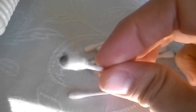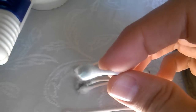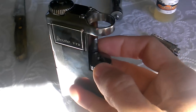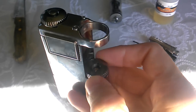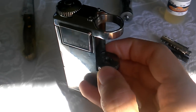If they're still coming out like this after you twist them in there, you still need to clean a lot more. They're not going to be absolutely perfect after you're done turning them in there, but once they start looking maybe a little bit clearer like that, then it's essentially about as clean as you're going to get with the alcohol. Also, when you're using the alcohol, make sure that you turn your base wheel. Especially if it's got a sandy kind of sound to it when you're turning it, just keep turning it with the alcohol in there until you feel it improve.